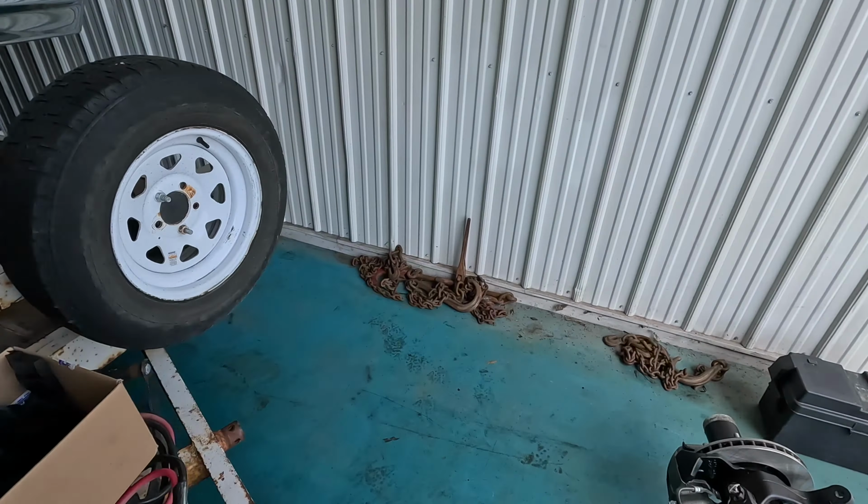And then in, I believe it was part one of this axle swap, I had mentioned that the studs on the trailing arm start to really rot away inside the trailing arm bushings. Let me show you what I'm talking about. These ones here, I don't know if you can see that. That's not supposed to be tapered in this area. That's supposed to be straight down with the threads. Those ones are pretty far gone. These ones have a little bit of rust here, but there is a lot more material on the two that were on the parts truck. So I cleaned those up, those are painted up.